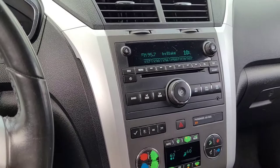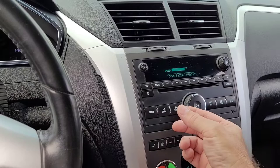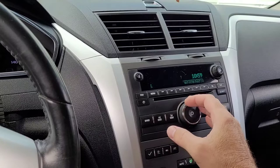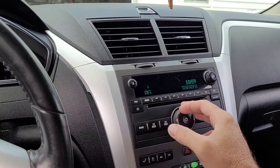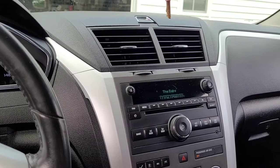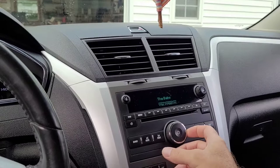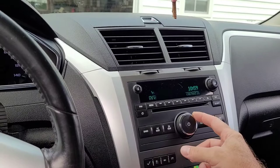It's starting to do it. As soon as things start warming up, it pops and the radio goes off. Eventually the radio just goes off completely and doesn't come back on. I've had speakers go bad in these cars before, but I've always had the tweeters up front still work. When this goes off, everything goes off, so I believe it's the amp cutting out.